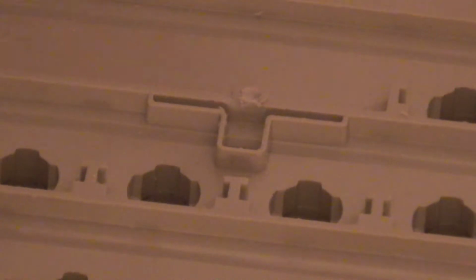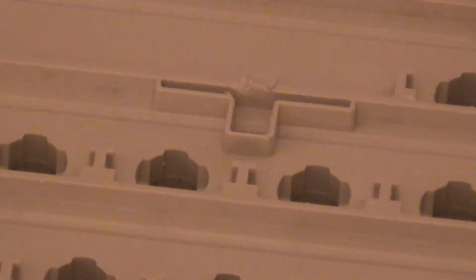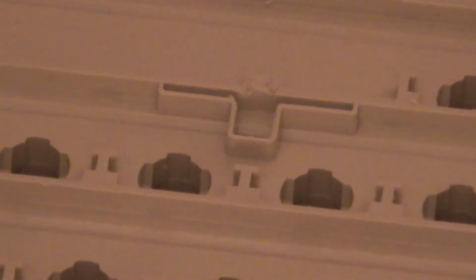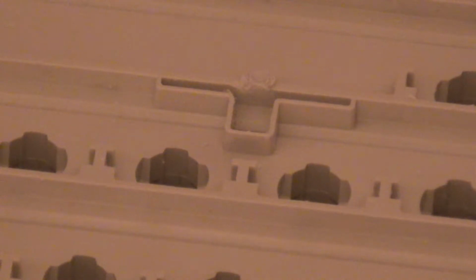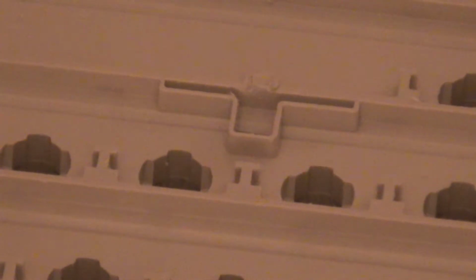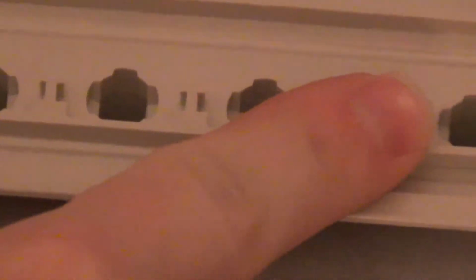Certainly wasn't the best attempt at it. I hope that's concave enough to get the drill bit to center in. A little bit of tolerance is allowed, but it's basically that same process for like every hole in the barrel plate. In fact, let's do another one right there.